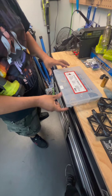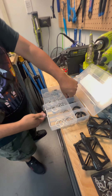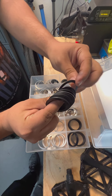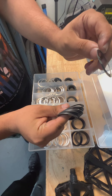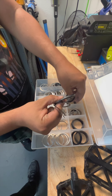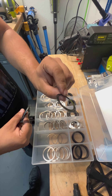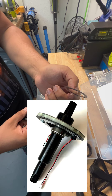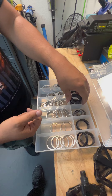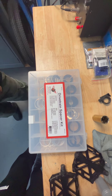So this is a drivetrain spacer kit. You can go to your local bike shop and get this spacer from almost anywhere, but the one we're looking for is a BB-30 spacer — and we're looking for not the 1mm, but the 0.5mm. So it's a real thin spacer. You're going to put that behind your sprag clutch assembly, and once you pop that in there, it removes the play in your sprag clutch. Your Tongsheng motor is one step closer to being good.